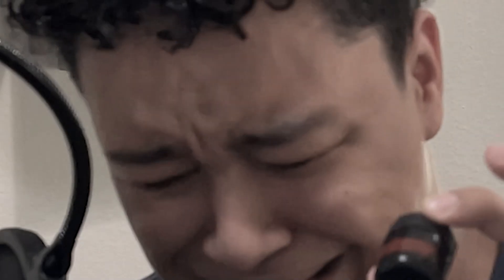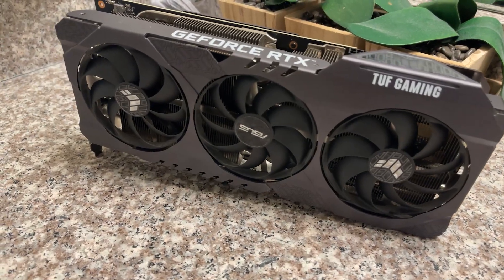Switching to the copper plate with Thermal Grizzly paste yielded slightly better results, although I don't know if it's enough to say go buy the plate and this $100 tube of thermal paste — yes, I actually spent $100 on this. However, there's nothing wrong with gaining a few extra degrees of comfort. This last 30 days of using my GPU with the copper mod has yielded no issues, no errors, no problems, and I'm really happy with how it's performed. Let me know if copper modding your GPU is something you're interested in doing. If you enjoyed the video, make sure to leave a like. Have a great rest of your day or night — I'll see you in the next one.